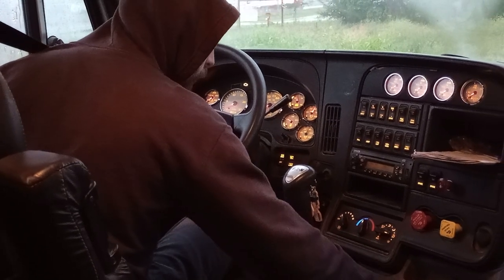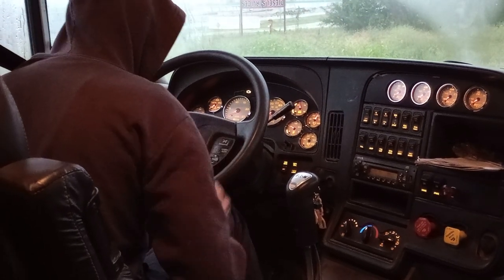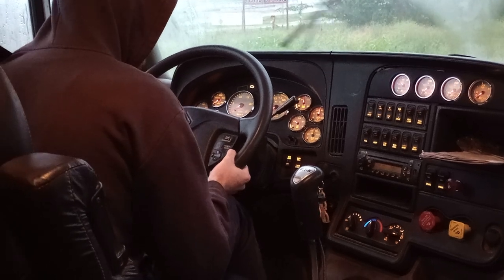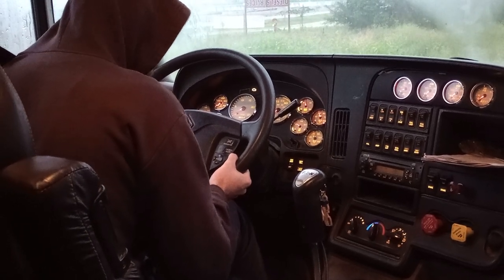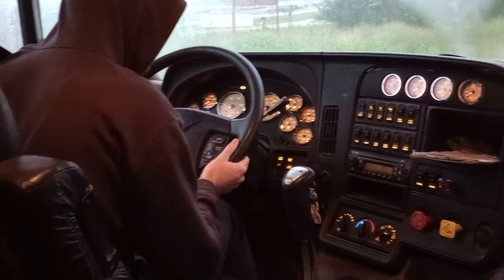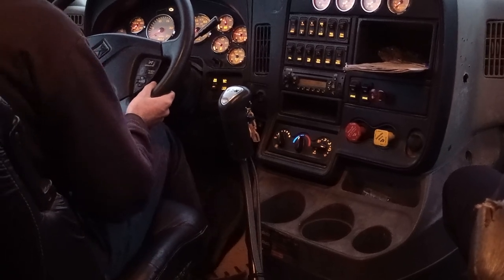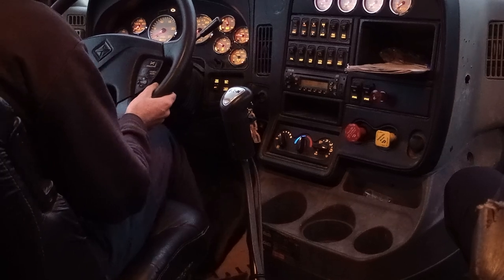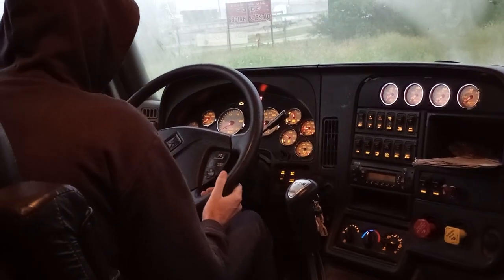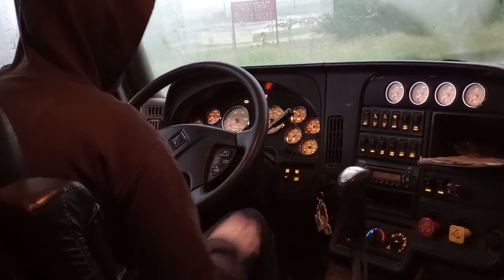Okay, after that, I would fan the brakes down to around 60 PSI, and the warning lights should come on. I'm testing the warning lights. There's one, and then there's two for both systems. I'm going to continue to fan the brakes down to test my spring brakes. Around 20 to 40 PSI, these valves should pop out, and the spring brakes should engage. There's... have engaged. And now I will make sure I'm in neutral because I will perform a safe start.